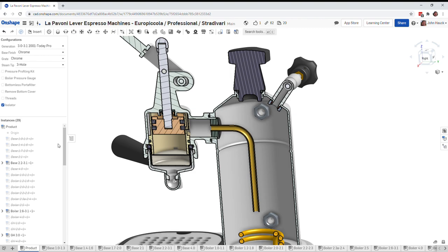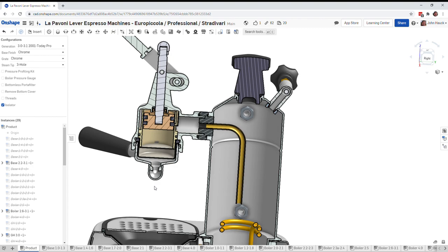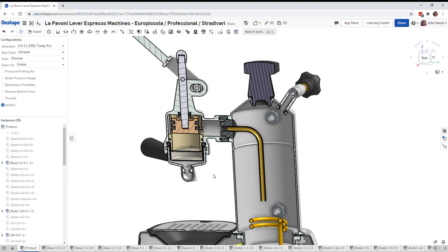So there you go. It's been installed here, provides a thermal block. The group head, you can see it comes out about 12 millimeters further than it does before. But other than that, there's really not a big change. But I do think performance-wise, there's a change because it definitely keeps the group head cooler. But in terms of the functionality of the group head, it's not that big of a difference.